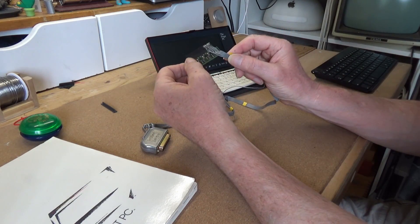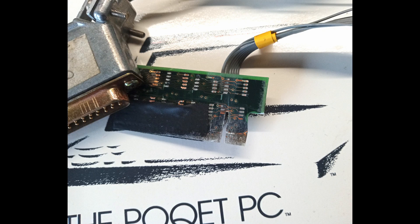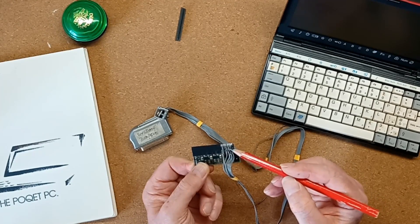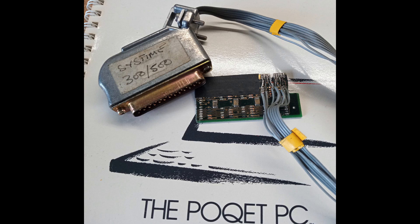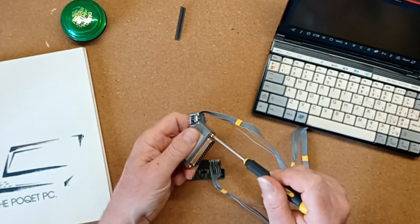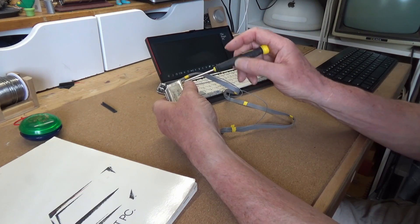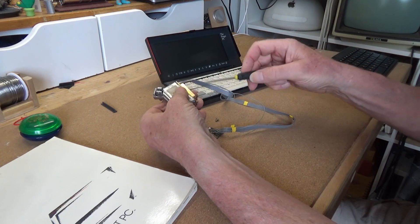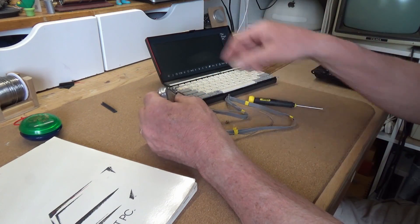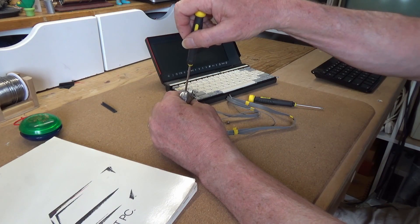When I acquired the Pocket, the first thing I wanted to do was to transfer some useful software to it. At the time I was heavily into listening to and decoding data modes on shortwave, and my goal was to create a portable, pocketable shortwave decode station using my Sony SW100 shortwave radio and the Pocket. The difficulty is that whereas all the necessary signals are available, they appear on a non-standard single expansion port at the rear of the machine. A serial adapter was available but these were pretty rare back in 1998. Examining the pitch of the contacts within the port, I realised they were the same as a DIMM memory module I happened to have lying around.